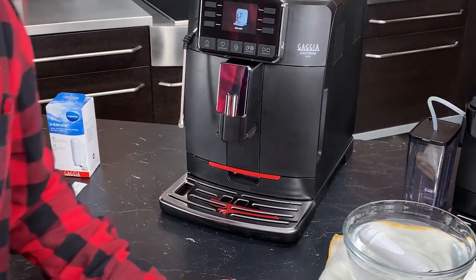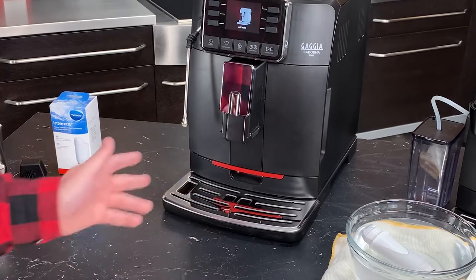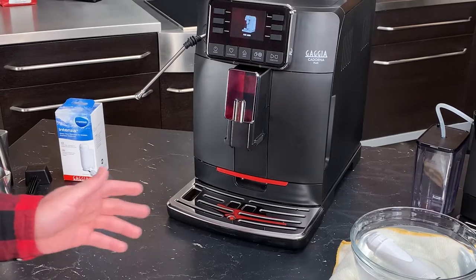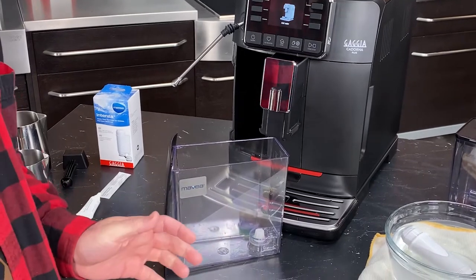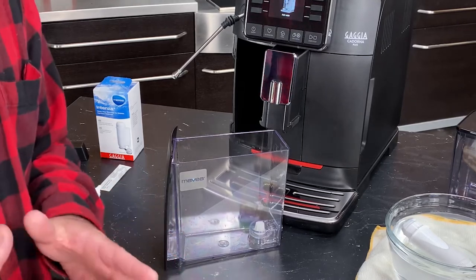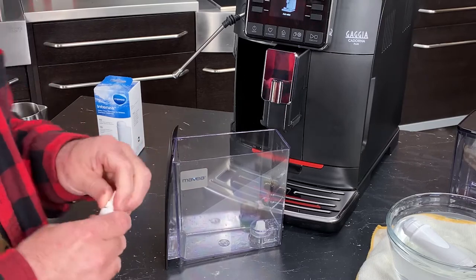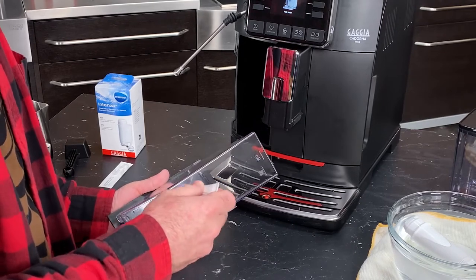Our water filter is being prepped and our water hardness test results are on the way. The first thing you're going to want to do with your machine is get your reservoir prepped for use. Simply position the steam wand or cap and cup out of the way if you're using a Cadorna Plus or Cadorna Milk, and then remove the reservoir. For some customers, there's concern about pulling too hard on the reservoir — fear that they may damage the machine. Keep in mind you are not in any danger of doing so, but we've come up with a solution using the included brew group lubricant that can actually help you. All you need to do is take the tube of lubricant and apply just a little bit to the inner diameter of your water inlet.